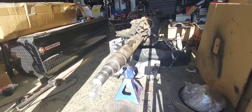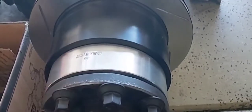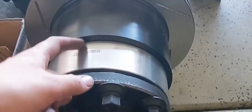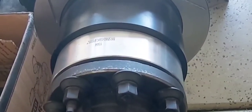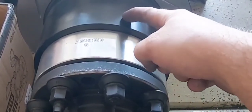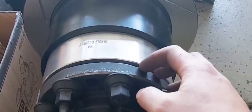I pulled the caliper back off this side, cut the tack welds on the caliper bracket, and pulled the bracket off. I'm going to be milling out the inside of this to fit the hub instead of having this two-inch spacer in here. On the 22-inch wheels, caliper spacing isn't a big issue for me. I'm going to mill the inside out to 130 hub center, just like the spacer is, to mount up to the back side of the hub.